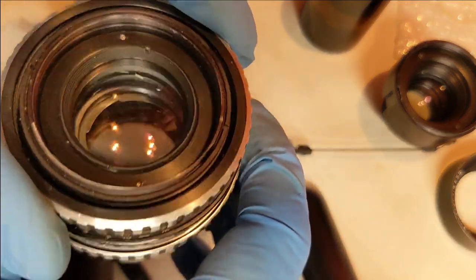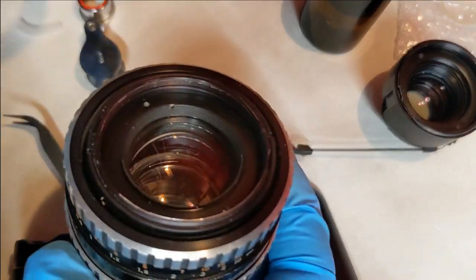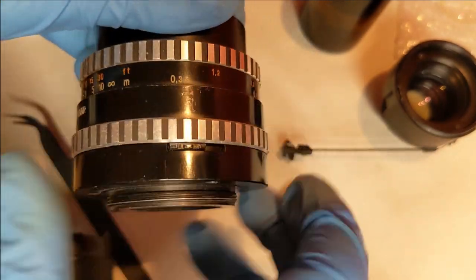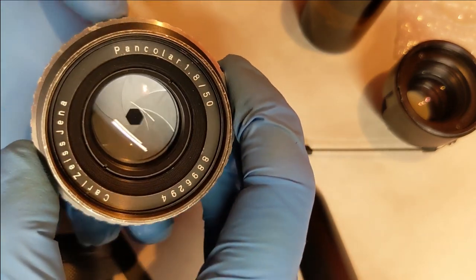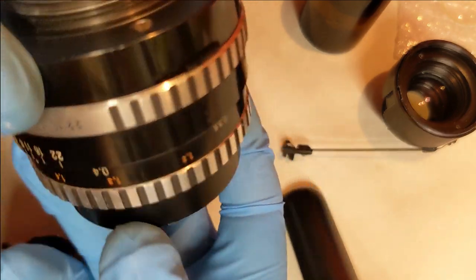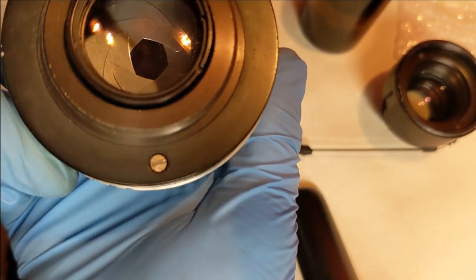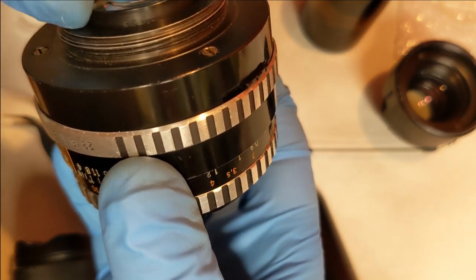While I'm here I might as well do the back lens elements too, because they're a collection of elements and that's usually where I find a lot of the fungus. The front of the lens where the filter goes on had a little dimple which I've hammered out with a rubber mallet in the shed — that's the only bit you're not seeing. This should be quite a straightforward fix — I should be able to grip the back of that lens and simply twist the elements out without needing to open it again.